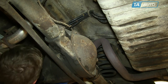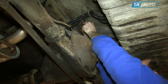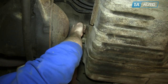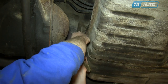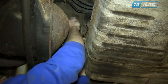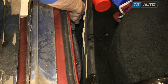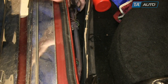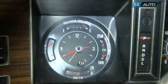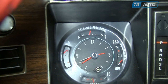Always replace the hoses with new hoses that will work with the new gas. To reconnect the ground strap, use a wire brush to wire brush a spot to bare metal on the body so that the ground strap gets a good connection, then use that 5/16th bolt and tighten it up. Reconnect the sending unit wire and make sure that the rubber plug is pulled all the way up through. Then turn the key on — it used to read full all the time, but now it's correctly reading a very low fuel level.